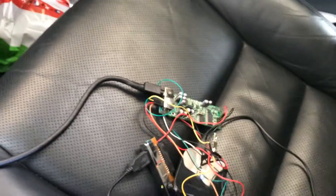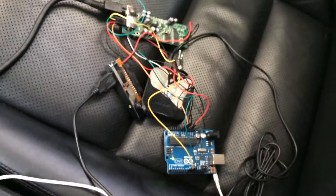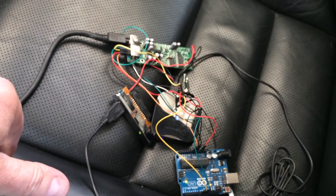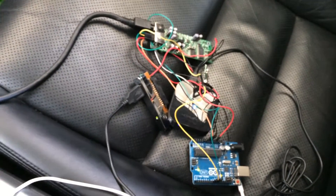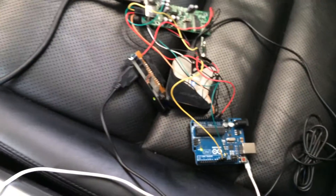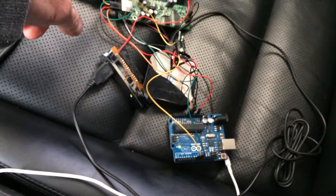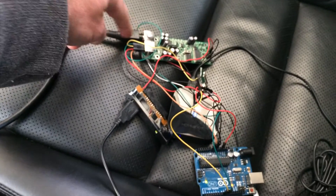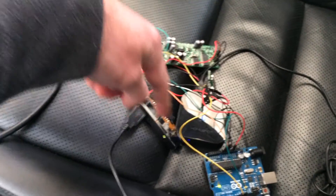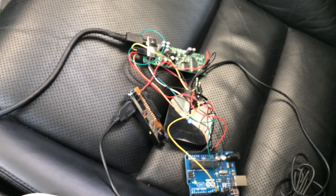I'm going to make it look like more of a finished box and use it in my Acura. I'm going to publish the source code for Arduino and all the wiring so people know how to replicate it. It's pretty inexpensive — the Arduino costs about 20 bucks, this Bluetooth adapter you can find for 10 bucks, and power is supplied entirely from the Acura Music Link: 12 volts to the Arduino and 5 volts to the Bluetooth adapter. Too many wires, but it's very simple in effect.